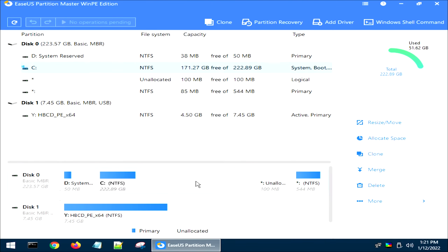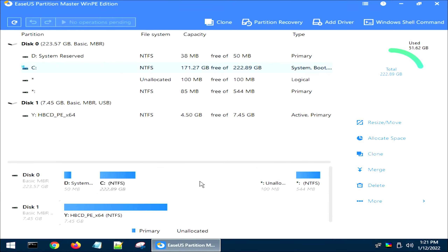Now the drive has run all pending operations, so everything's done. The next thing I'm going to do is completely optional and has a little bit of danger in it, so be cautious. If your system doesn't look exactly like mine, just disregard the next few steps — they are optional. At this point the system will boot into Windows, at least it should. But I'm going to show you how to clean it up to make it exactly the way it was when it was first put together. So if your partition layout looks exactly like mine, you should be able to do this. If it doesn't, it means you have some proprietary partitions from the manufacturer and you may not want to follow these next steps.